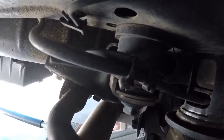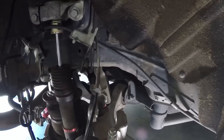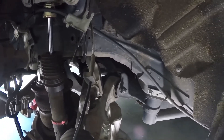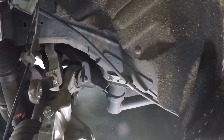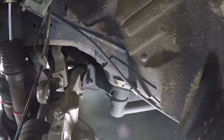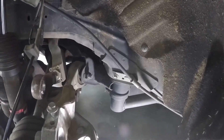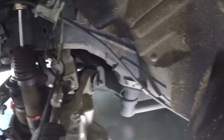So without pinning that together, your subframe can move every which way — front, back, side to side, up, down. The lockout is obviously pinning the subframe to the car. Now, whether you get any increase in NVH, I can't really comment. I don't believe so. Maybe a clunk every now and then, possibly. Not in my car, but I have heard of it.